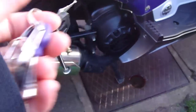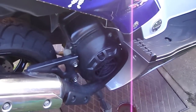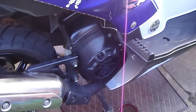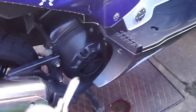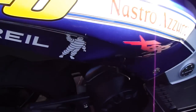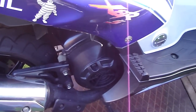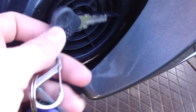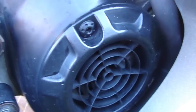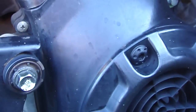It's air-cooled, which could be a bad thing for some people or a good thing for others. Air-cooled makes it a lot lighter, which you want on a moped. But supposedly it doesn't cool the engine as well. With my one, though, I've never had any problems at all. I've gone on rides for about four hours straight and haven't had the slightest problem with engine overheating, even in traffic for long periods. The fan in here can really suck hard — I can feel it when I put my hand there. I've got stock exhaust.